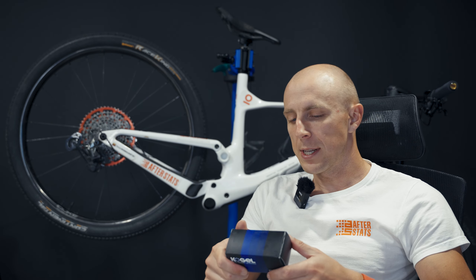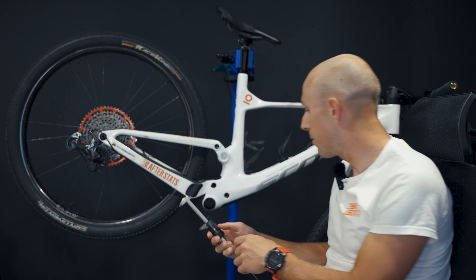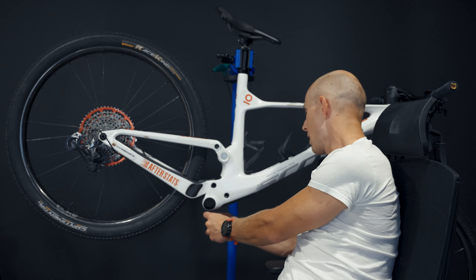The reason I chose this is already covered, but basically I just have an urge to figure out whether there is some sort of difference when using these bearings. These are the ABB 8692, and if you are not aware yet, the bottom bracket of the Spark has a shell width of 92mm. Hopefully this will work — we will see.